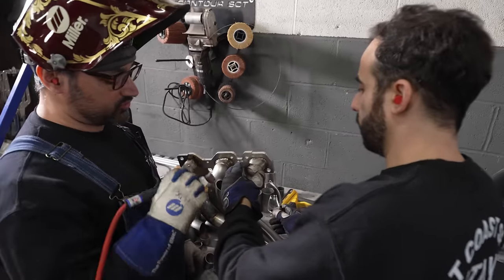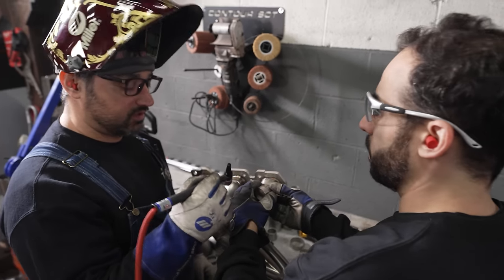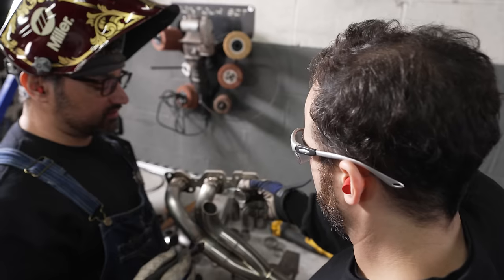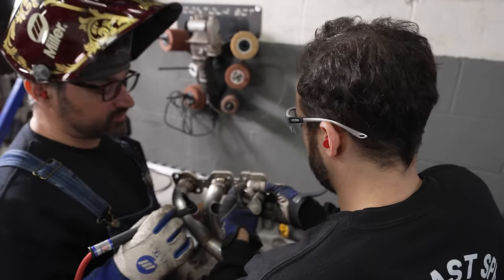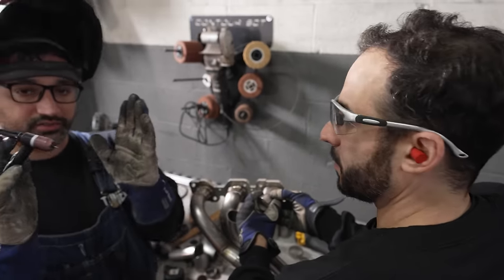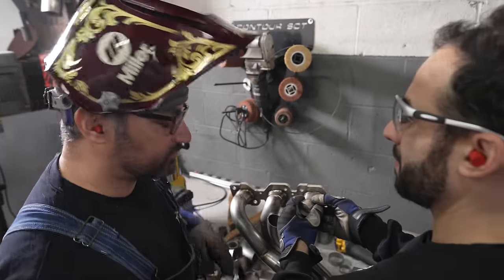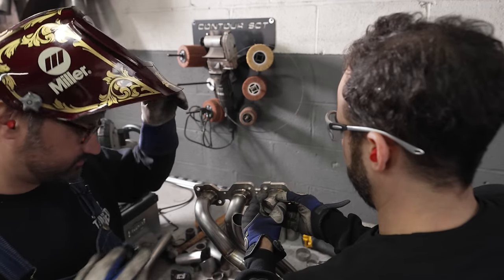Cool. All right. So we need a super tight bend for this last, the 12 out of 12 primary tube. And we're going to just do Japanese JDM style, cutting little wedges out, lobster tail style, they call them. What else they call them? Pie cuts. Pie cuts, that's it. We'll call them pizza pie cuts. You just take a straight tube and cut a wedge out of it, and if you weld them all together in an incredibly time-consuming and boring fashion, you do wind up with a very tight bend. So that's what we're gonna rock with.